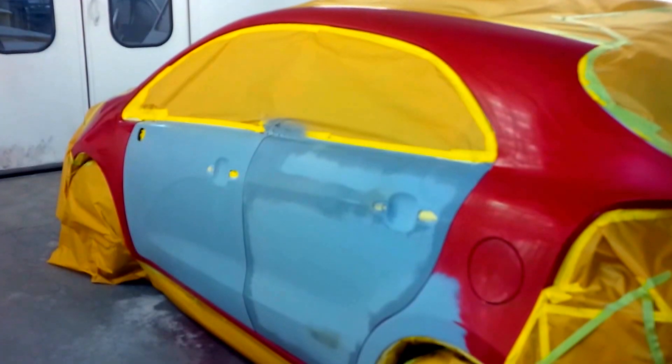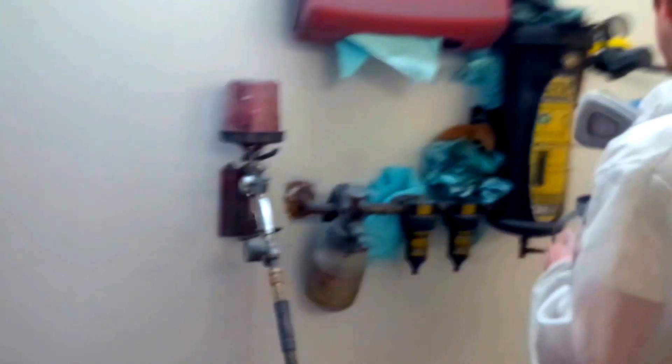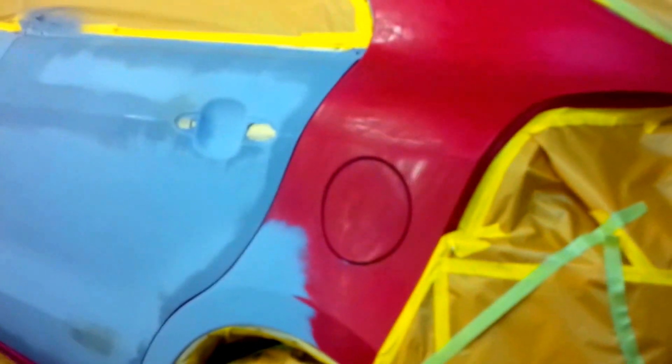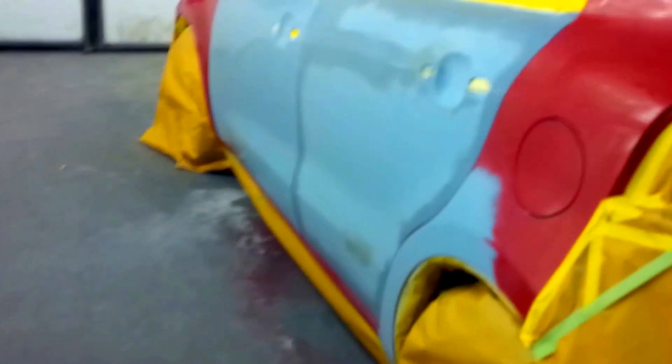Starting with the prep work, we're going to look at these finger marks in the blend panels and the multi-colored primer. We've got a lot of gray, white, light gray, and medium gray — different shades of primer going on. Ideally you want to have one shade of undercoat, and ideally the proper value that would complement this color best and help with coverage. It's not going to be a huge issue today — we're using Onyx production solvent and the solid colors cover extremely quick — but still, it is best to have a proper undercoat.